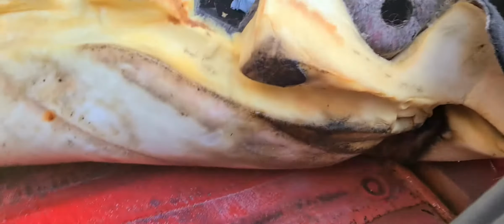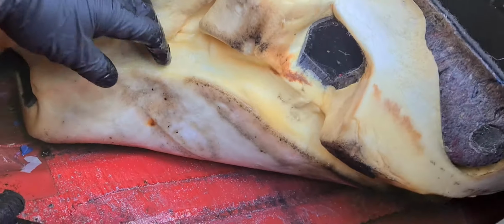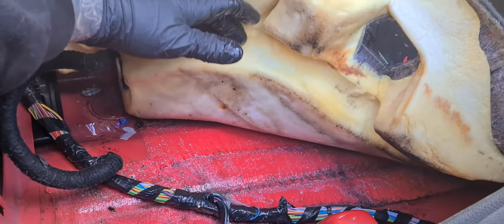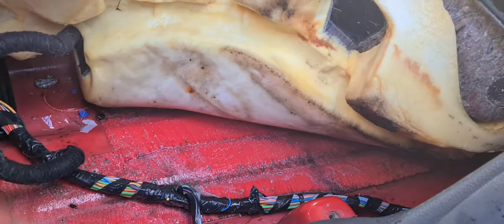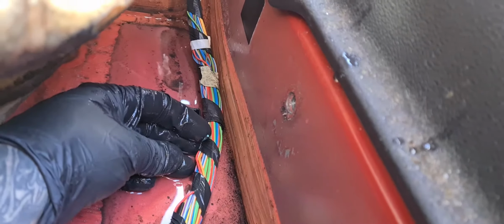Seat strips out, we've got a load of what looks like soapy water, so I assume we've got the screen wash leaking in somewhere, and we've just clocked a little bit of discolouring, and we found the colour of money there, green wire. So the keyless remote didn't work, central locking due to that faulty wire, so no parts required on this one.